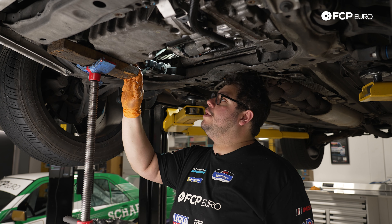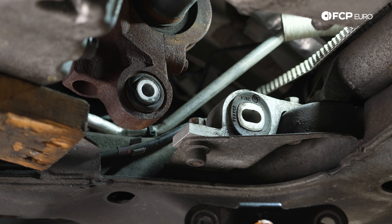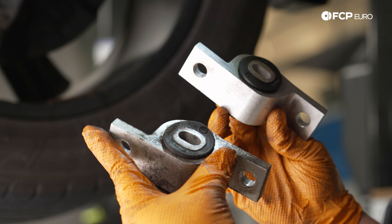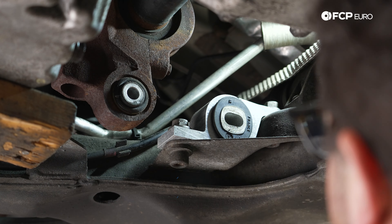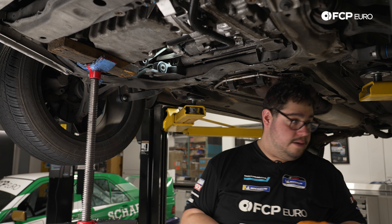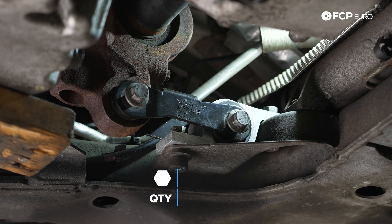With the screw jack repositioned, there are two 15mm bolts to remove first, then pull off the bracket. Note: the connecting part faces up and the Volvo logo is right side up. There are two more 15mm bolts holding the mount to the subframe. Install the new mount the same way it came off — there's really no wrong orientation. Snug and torque the subframe bolts to 80 newton meters, reinstall the bracket with nuts on the backside and Volvo logo up, snug with the impact, and torque down.